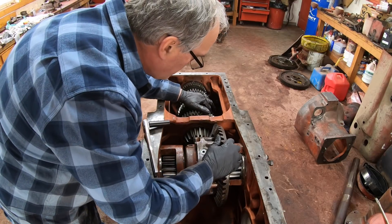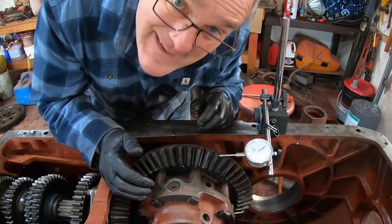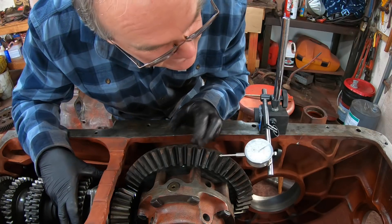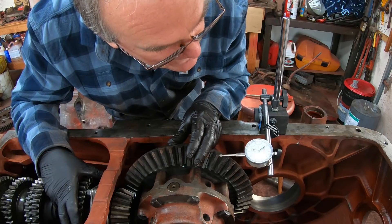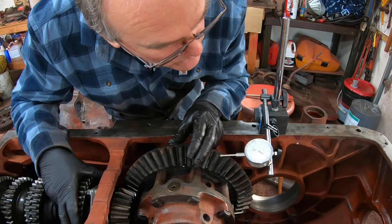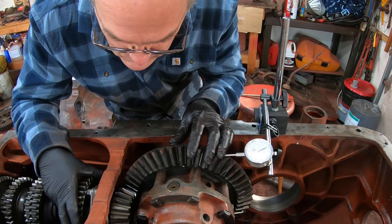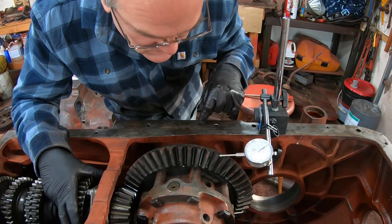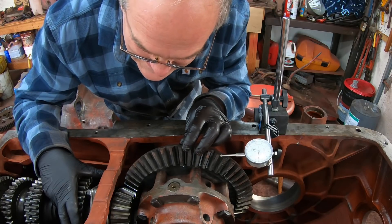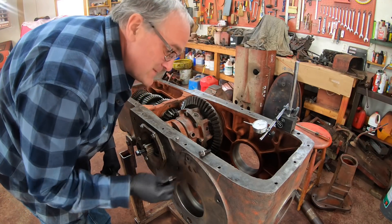Next let's lock this into gear. That is my differential backlash. The next step—and this is kind of a pain—is to measure backlash on the ring and pinion. I set up a dial indicator and I've got about twenty-two thousandths. Backlash spec is eight to twelve thousandths, so in order to bring the ring gear in tighter to the pinion and reduce the backlash, I have to add shims to that side and take shims away from the other side. It all has to come back apart and be readjusted until it's within spec. That's way too much play, so I'll go to work taking this pinion cage off. It takes a little patience—something I didn't plan on having to do.